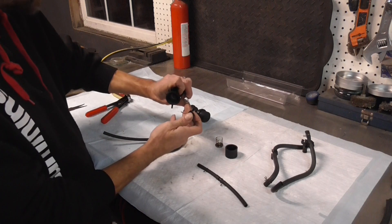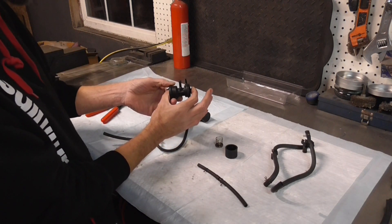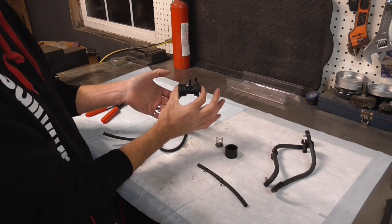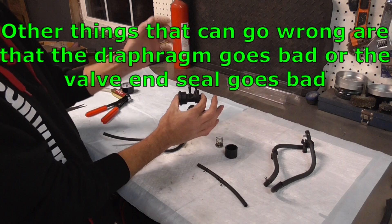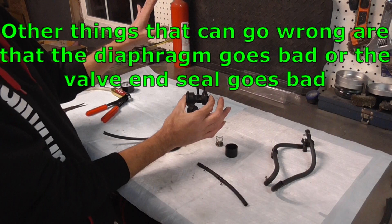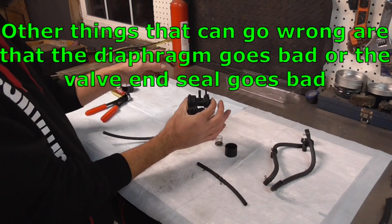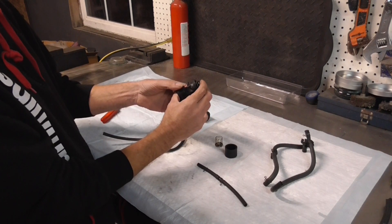What went wrong with this one is that the plunger is corroded — you can see the spring has got corrosion on it. When it went to plunge in, it got stuck, and when it got stuck it opened up that side and air was flowing all the time. Too much air into the carburetor killed my front cylinder, so I took them off, blocked off the ports, and away we went.